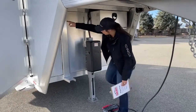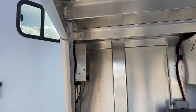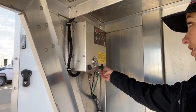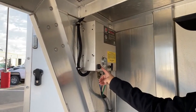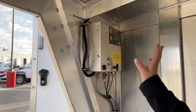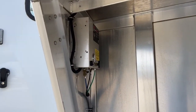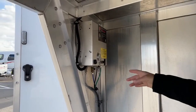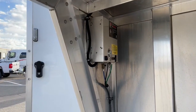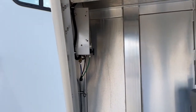Over here in the corner, this trailer is equipped with air ride suspension. That is your air ride control center — this is your compressor. You've got your raise the trailer, lower the trailer, on and off switch, and your dump valve for the tank. It is self-regulating. It's going to put air in those bags, and as you go over bumps and lose air, that compressor — as long as you have it in the on position — will kick itself back on, get air back in those bags, and get them to where they need to be.